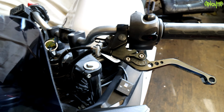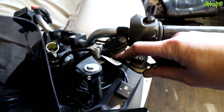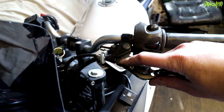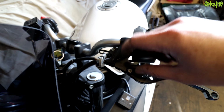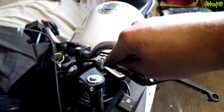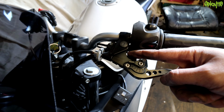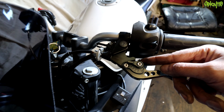The only issue is, I say, that the bits you have to be really careful of is how tightly you do up that barrel, and that's very difficult to do unless you've got a decent sized ratchet with you, and you also need pliers and screws and screwdrivers and whatever it takes to get the panel off your bike. You're also going to need a cutter if you're going to cut it, if it's like down to a strand and it's all jamming up. So you're not going to pull this out of your back pocket and just fix your clutch cable without any tools. You're going to have a whole kit with you.